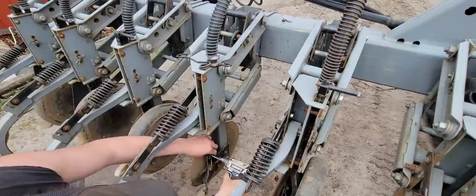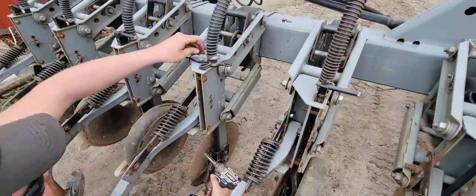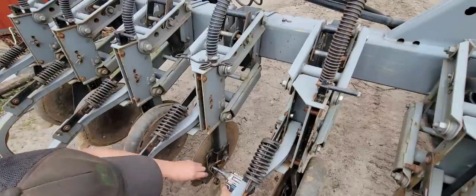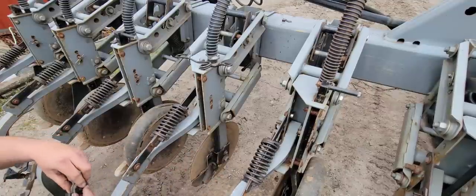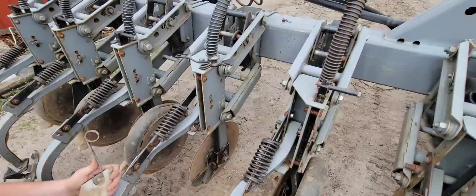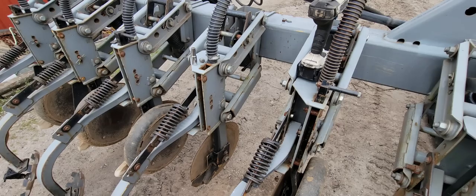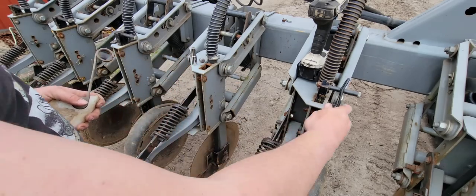So these springs — just buzz off these two bolts with a 7/16ths socket. Pretty simple, there's just a bar that they thread into. Take it off. Note that there are rights and lefts to these springs, so you have to make sure you have the right one.